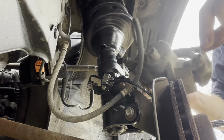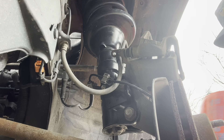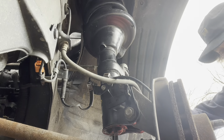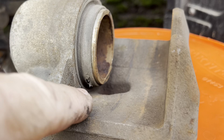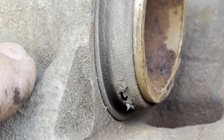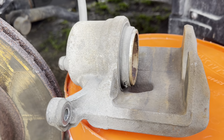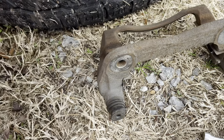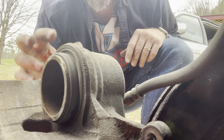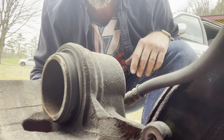This is the hose I was talking about on my other brake caliper — this flat surface that it's supposed to mate against was dented and it would not seal. So I drove to work with leaking brakes and almost no brakes. I had to use a parking brake to get where I was going. There's only a couple things that can cause a brake caliper to lock up. One of these pins, which we already know are in pretty good shape. So how I'm going to get this piston out is by getting in the car and pushing the brakes — when I push the brakes with no resistance against this, this piston's going to pop right out of there.